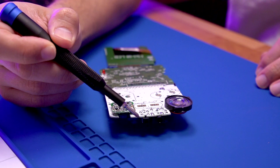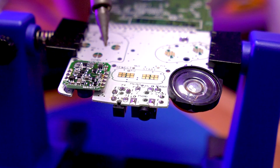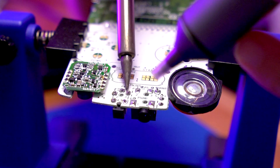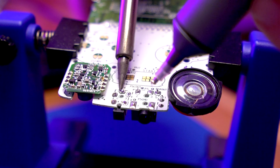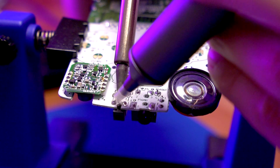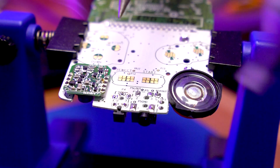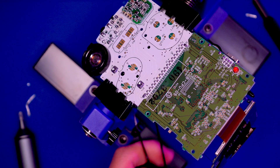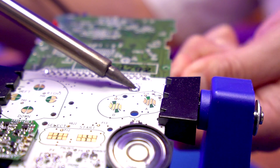This is the area we're going to desolder — the DC input adapter that we're going to take out. Put your motherboard onto your PCB holder, grab your solder sucker, and remove the solder from these five points. It really does help to have a solder sucker — I highly recommend it. While we're here, let's also desolder the positive battery terminal lead from the motherboard.